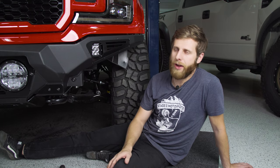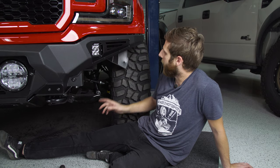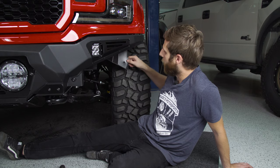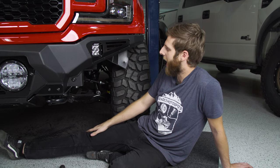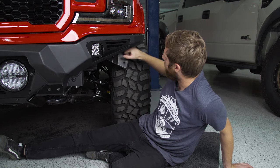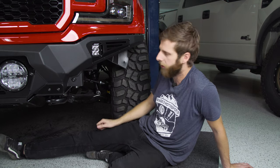The tow hooks are on — we're in the final countdown. If you haven't plugged in your fog lights and other connections, do that now. The last thing to knock out is cutting the inner fenders to trim up that little wing section. They're not super sturdy so you could use a box cutter, but we've got the Dremel hooked up — just slice through for a nice even line and maybe add a zip tie at the top to keep it stiff.